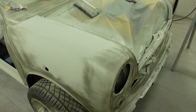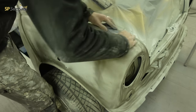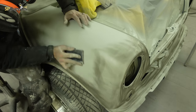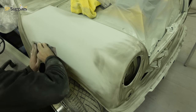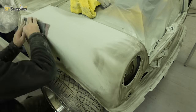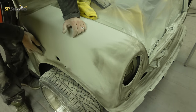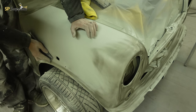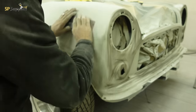What you're looking for is a consistent finish with no guide coat left along any of the edges. I'm using a semi-rigid block because this car has quite a lot of curves — you need a block that will slightly flex to the panel but flex in a straight line. With a soft foam block you could get a kinked flex, which you don't want. These little polycarbonate blocks are ideal — they've got a nice even flex across their length, really good for concave panels like this.